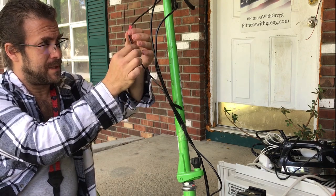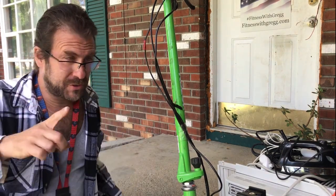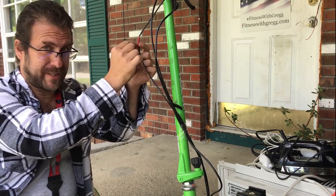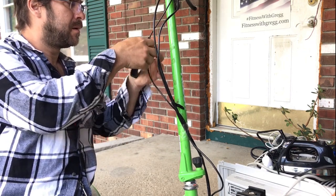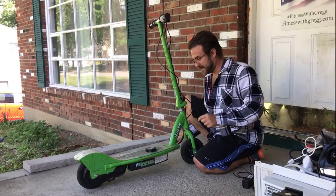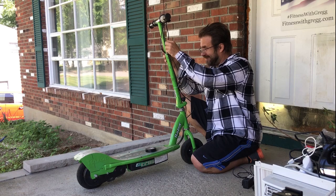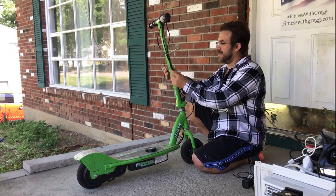There you go — two really pathetic bullets. I'm just gonna wrap this in electrical tape, and I'll probably in the future cut this off, strip one more so it's separated, and use nicer shrink-wrap bullets which I'd hit with a heat gun and they would shrink nicely. There you go, bundled up super — just a little zip tie to keep things neat so they don't get caught up when it's being ridden.